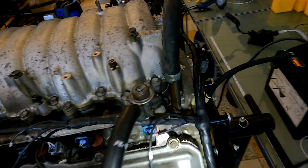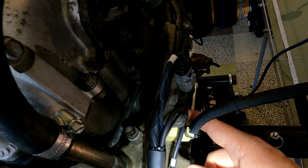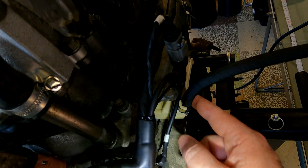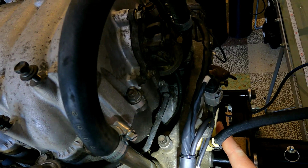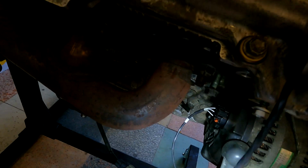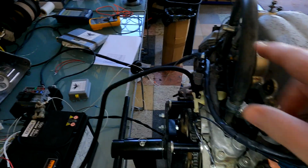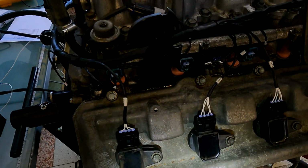All you've basically got to do is you've got your sub harness here. So that's your little white bracket over there. There's your main power cable, which I've got connected to the battery. So that's a separate harness section. There'll be a photo at the end showing you what it looks like underneath here. So stick around for that. And then you'll see all the photos, also the build and the completed harness itself. And then all you've got to basically do is connect the main power up to there, and then coming around to the alternator, you've just got your main power off your alternator here. So there's your alternator plug that goes in the back, there's your lambda plug that goes in there, and so that's basically it. Connect the wires up, connect the fuel, main power for the starter, main power for the alternator.